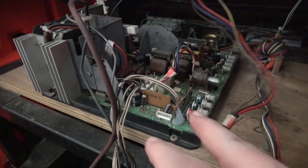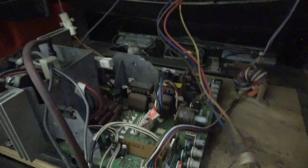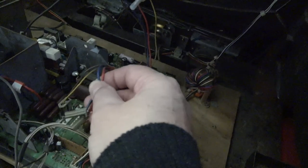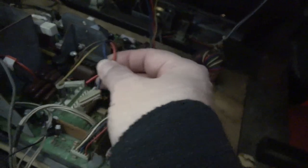We've got one shot at it. Let's get the chassis in and see if we can get the monitor back going. I've just put the board in the back here. The first set to connect is just on the front. Then we have the yoke wires - brown and yellow on this back one here, and blue and then red on the other set. These are normally joined together in a set of four, but the way the orientation is of the monitor these two would have had to have been cut to either reverse the screen or flip it.